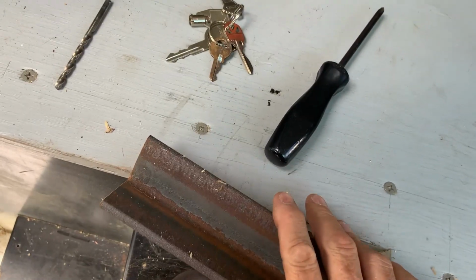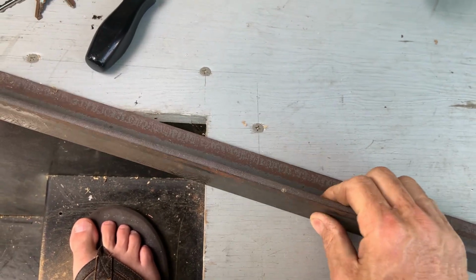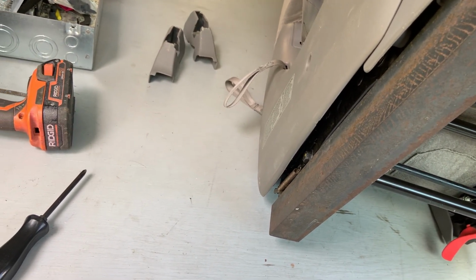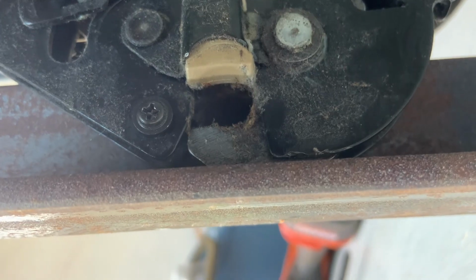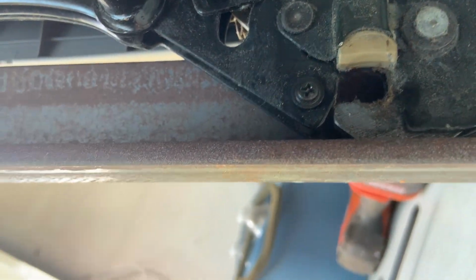So, I just dug up this piece of steel angle. It looks like 1.5 by 1/4 inch. And what I'm thinking I'm going to do is put it like that. This piece happens to be 36 inches long, and it might be long enough to do what I need to do. I'm kind of hoping. So this will give us a flat base that we can work with and attach our pivot base to. So you can see what we've got going on there. Being that this is a quarter inch thick piece of angle, it's got enough structural integrity that I can put a pin in it and weld it on the opposite side, and that'll be strong enough to support that.